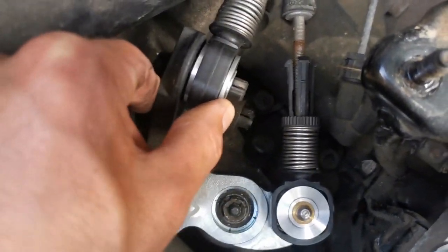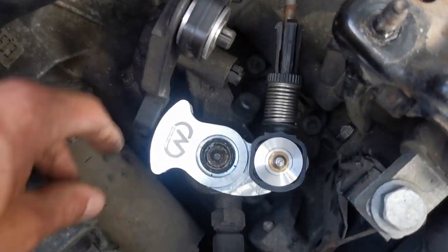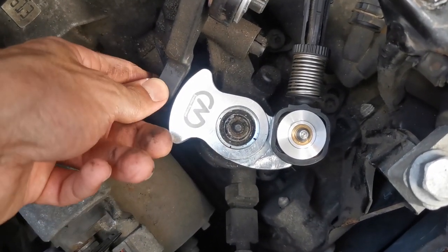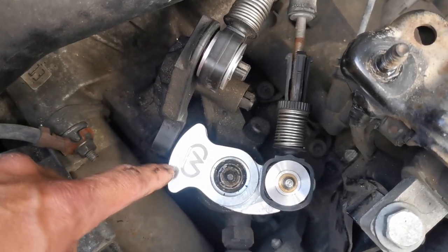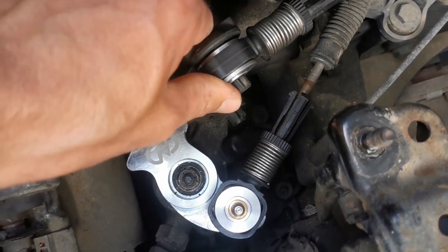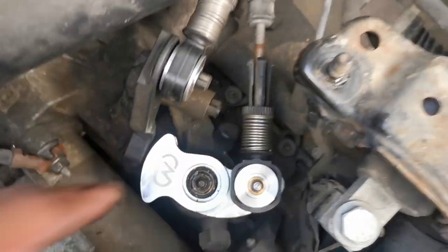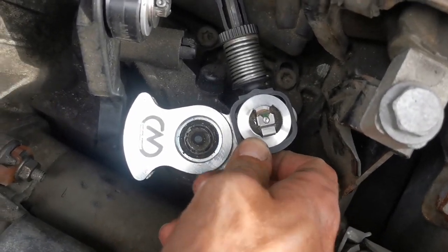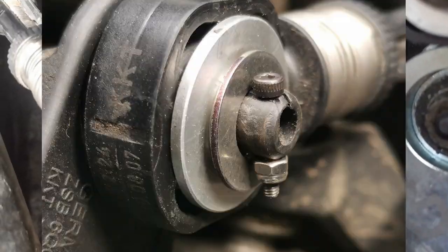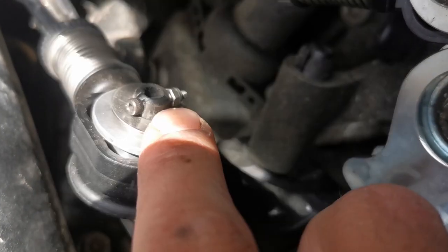I've only put them on loosely because I'll show you in the cabin, we have to reset the neutral position using a little pin first before we release the springs, and then before we release the pin here to release the gearbox essentially. So it's just putting everything in position first to make sure everything's right. And then obviously I've got to put the clips back on as well. This clip is now on. To combat the problem of this clip, we've had to put a retaining pin through the actual end of the plastic, like an M2 one with a nut on the end, drilled through the actual end of the plastic.